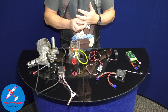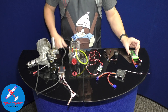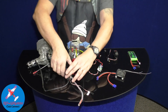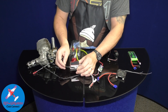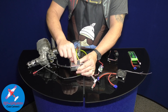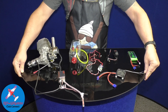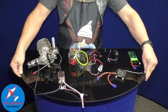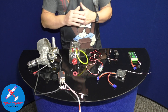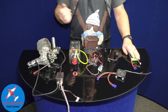Let's talk about how this works and what you need to think about when you're setting up a gas engine. The first thing to look at is your ignition — when you look at your ignition it will tell you the maximum voltage that can go into it. That's important because it really helps determine all of the steps of how you set this up. This is a six volt ignition, but I'm running 7.4 voltage to all my servos.